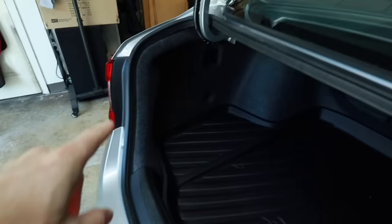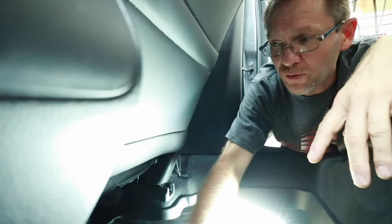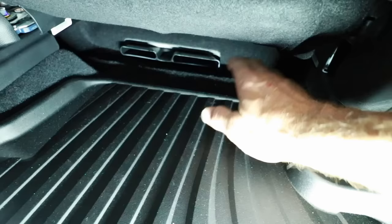We talked about a down-firing subwoofer so he can still put stuff on top of it — small footprint, sits in the trunk, doesn't take up a ton of room, and he can move it as needed. He really doesn't want to see any of the equipment. There's no room under the spare tire, and he wasn't keen on side panels. After looking around, we found the area underneath the passenger seat, which has a lot of room. The seat sits on risers, so we can build a panel that suspends over the floor, allows airflow to still come out, and mounts the amplifier firmly underneath the seat.